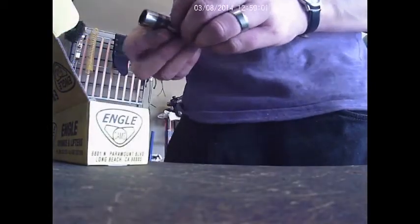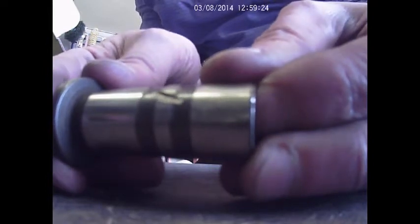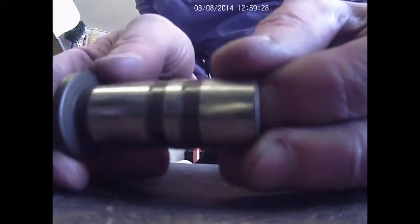Okay, entonces como vamos a modificar, we're gonna modify these tappets, these pushrod tappets. We're gonna make little grooves. You can see right there. See those grooves right there in the middle? Okay, that groove is so that it has oil 100% of the time. The valves will be oiled.